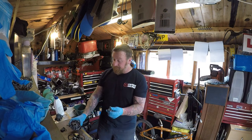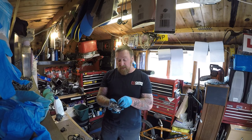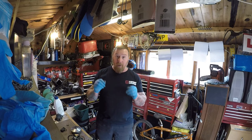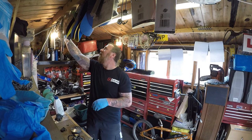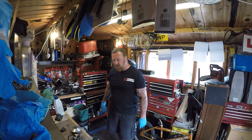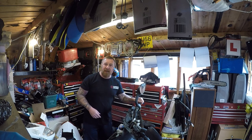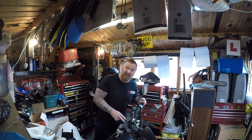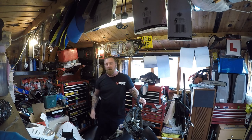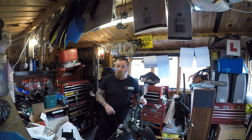I've only got four rollers in here. I'm going to be taking the variator apart in a little while, seeing how the variator system is and how the rollers are. I want this bike to perform really well — I don't want the person thinking they've got a bad bike that pulls very slowly. So I'm going to take the variator off, clean it, check it, weigh the rollers. I've got another set somewhere. Coming up next is the front end — front wheel bearing and headstock. Thank you so much for watching, please like, share and subscribe. So many little bits and bobs still to do on this bike to get it to what I'd class as road worthy.